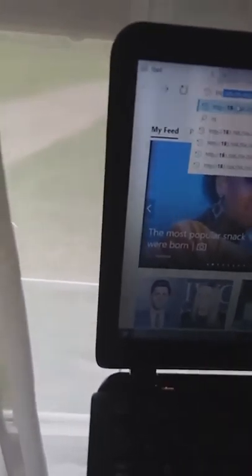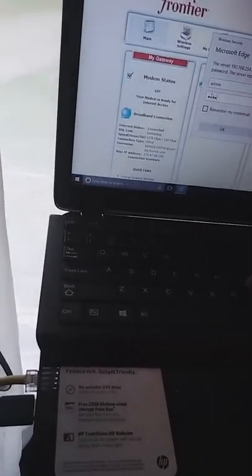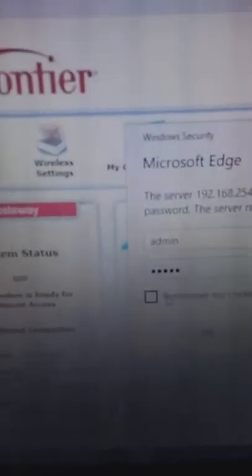Come up to the top of your search bar and type in 192.168.254.254, then press Enter. You'll probably get a login page. If nothing has been changed, the username and password should both be 'admin' — all lowercase, A-D-M-I-N — for both the username and password.